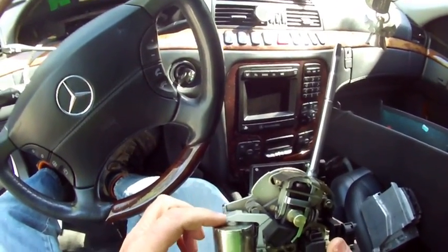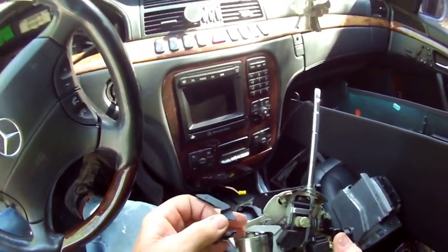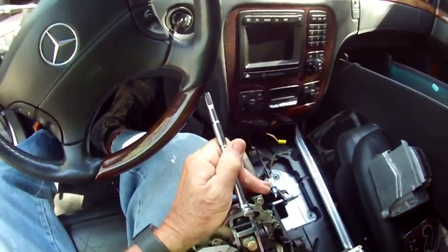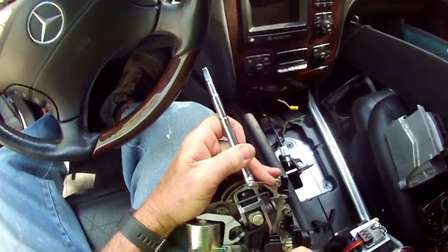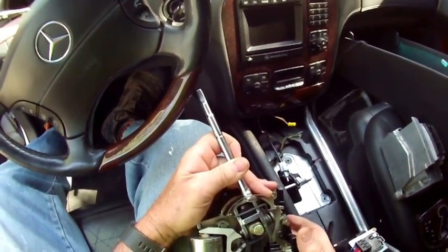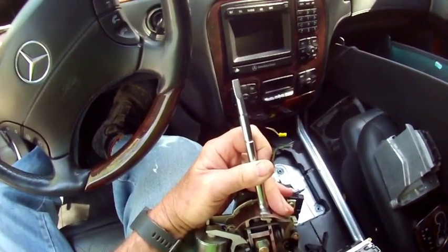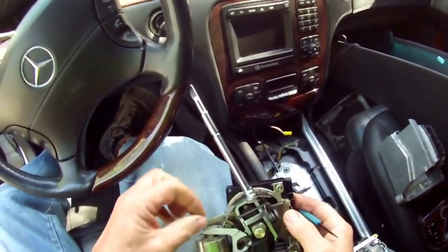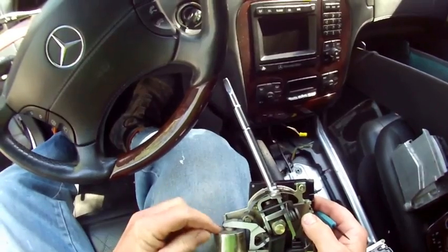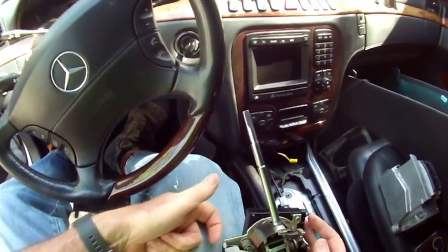So that's how your shifter works. If you're stuck in park and can't get it open, you have to get this thing out, get that cover off, and see if your plastic part here is broken - that's this guy. If you get a new part it'll be aluminum and come with a spring. I had to put super glue gel on the spring to hold it in the arm - there's no way to get the little nub on the shifter into the little hole without the spring bouncing all over. Super gluing it on allows you to get the arm installed. To get this arm out, there is a dowel pin right here - come in with something small, knock that dowel pin out, get this down into like the drive position, and then with the pin out you'll be able to lift this arm up, twisted a certain way, and get it over that pin.